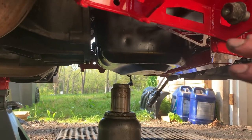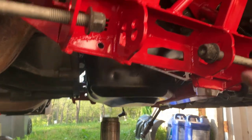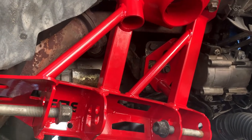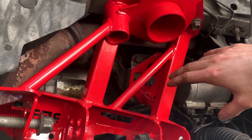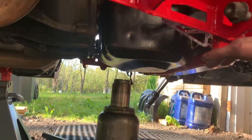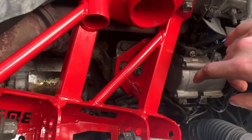When you drop the old K member, the engine is going to sag down a little bit and you're not even going to notice it. This was one of the issues I came across when putting the new K member in — it looked like it wasn't going to fit. I waited months and months because they were back-ordered, and I thought maybe they shipped me an old one. But what happened was the engine sagged down, which threw off the geometry a little bit. I figured that out and was able to use the jack to lift it up just a couple of inches until I got the K member pretty much flush with the frame as well as down here on the subframe.